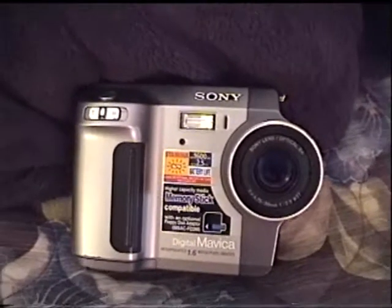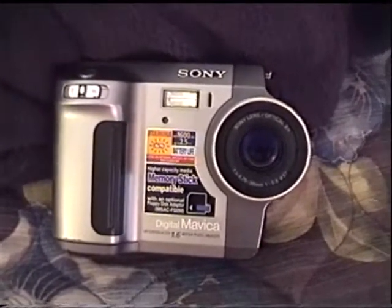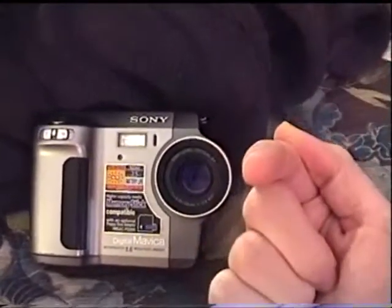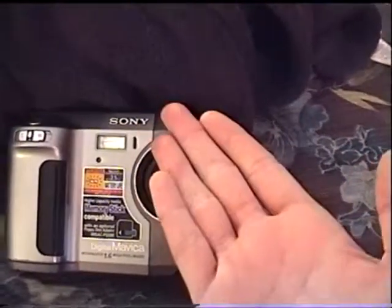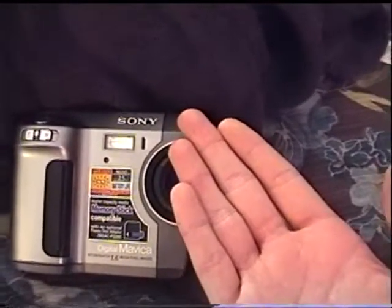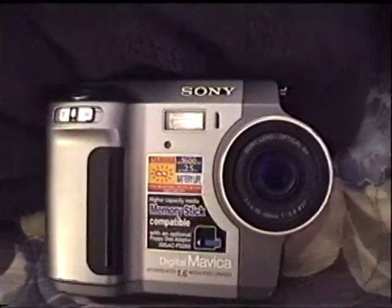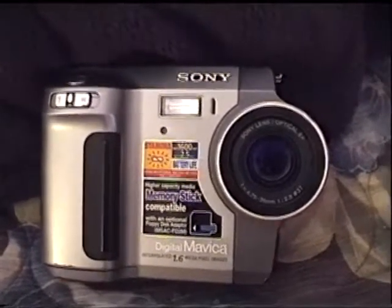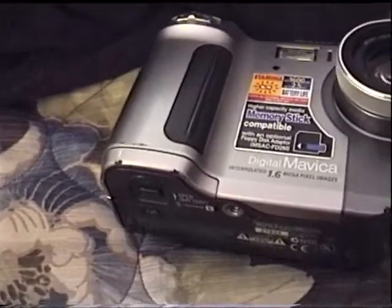Very stupid. I don't get why, because the older Mavicas don't care if the battery has working InfoLithium circuitry or not. Nor does my High 8 Handycam. I'm running a generic battery with non-functional InfoLithium circuitry in this camcorder right now, and it works just fine. And it's actually one of my better batteries. It runs this camcorder for hours. But yeah, unfortunately, you need to use a battery that has functional InfoLithium circuitry, or this camera will refuse to power on. Too bad. So that limits your options, and it introduces a bit of risk if you're buying generic batteries or used Sony batteries.